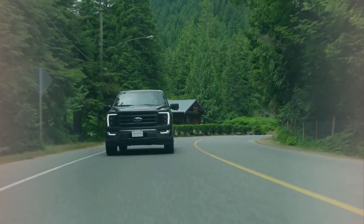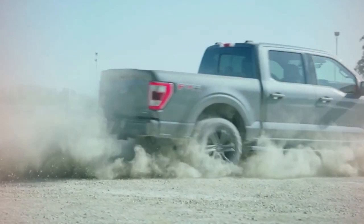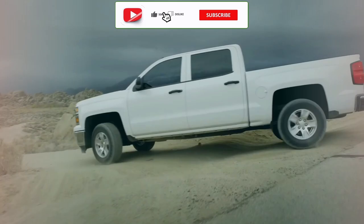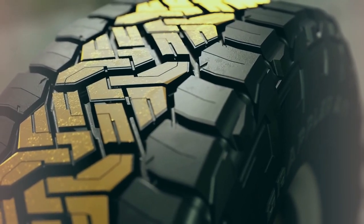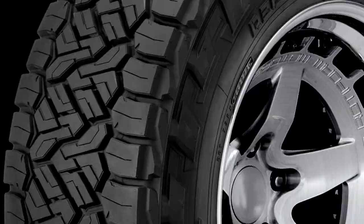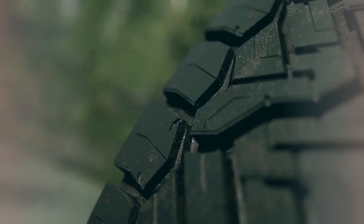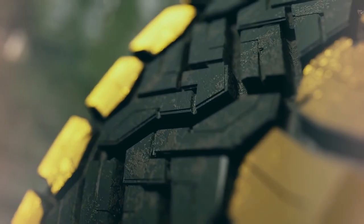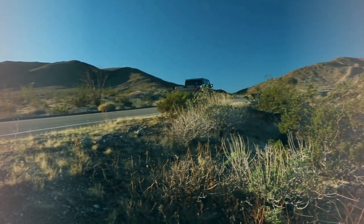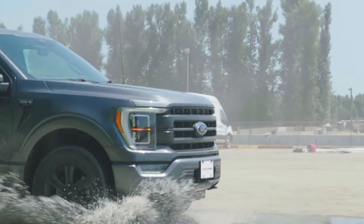In terms of performance, the Recon Grappler provides a better on-road experience than the Ridge, while also offering greater off-road performance compared to the Terra Grappler. The tire basically provides an aggressive design without compromising too much on-road comfort. The staggered shoulder blocks are scalloped and have reinforced foundations where no stone ejectors are embedded — instead they have ridges in between. This forms aggressive shoulders while also locking the movement of the blocks, making them great for on-road handling.